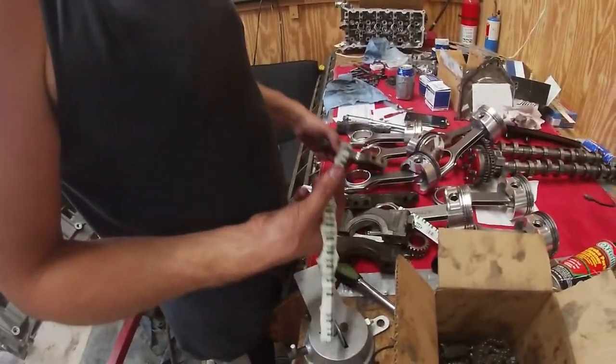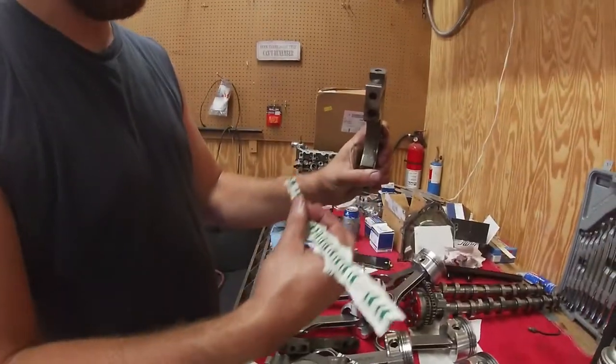This one right here went a little wide — it's almost like a 1 thou, which looks really tight. That's the only main cap I'm not that happy about. But on the other side of it went to about 2 thou.